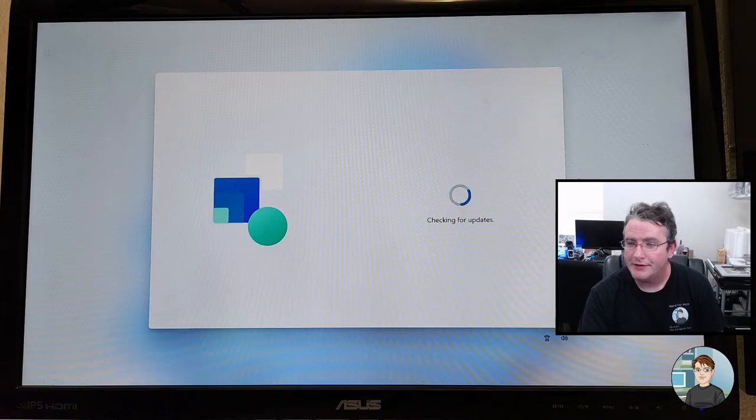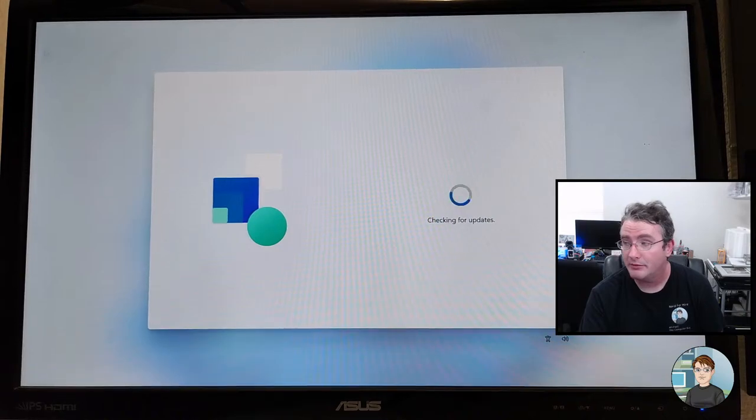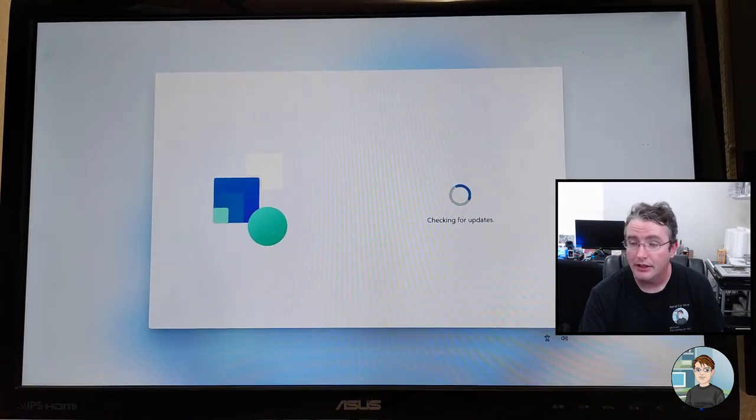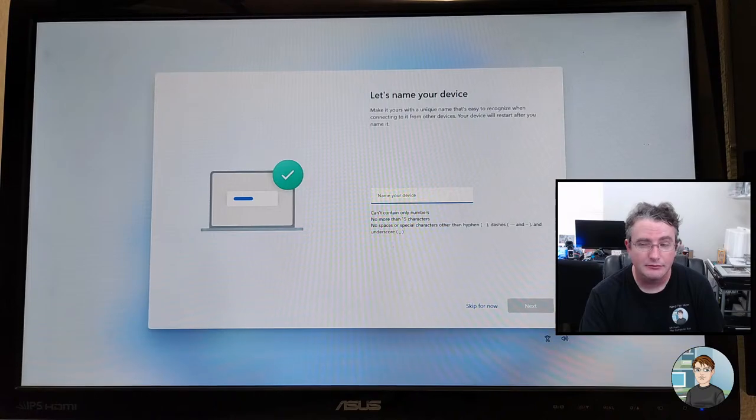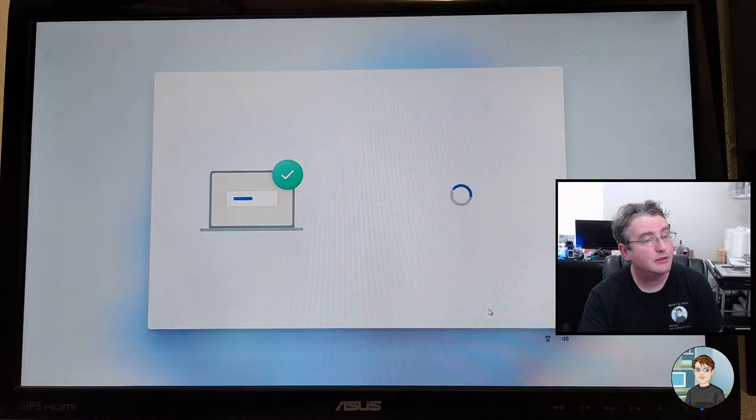Video card showed artifacts on the monitor days ago, but now it works normally. What should I do? If the graphics card is still in warranty, I would call the manufacturer and ask them about it and see what they say. But artifacts is kind of a generic term. Was it lines? Was it little dots? Were the dots moving? What were you doing when it happened? Were you gaming? That kind of thing. It's all things to look at.